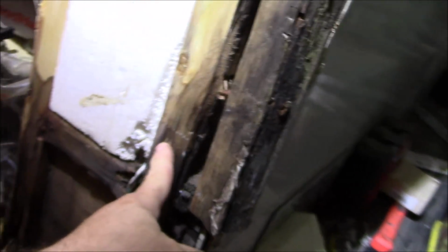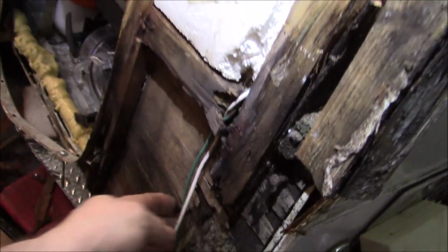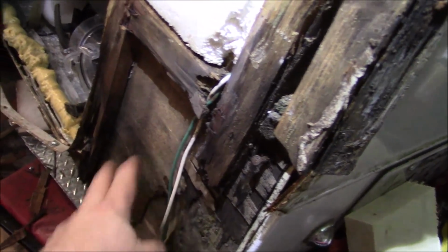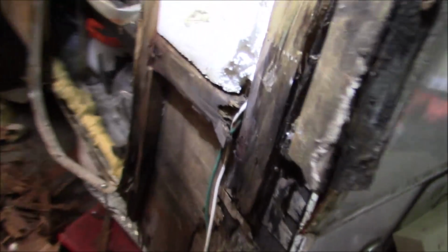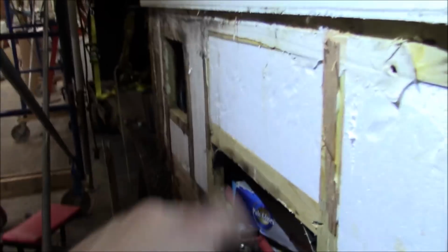We'd put some more struts and everything. Obviously, this is going to get replaced. This goes inside. I'm not going to replace all that, but I will throw some mold kill on there, because then I'll get inside the cabinet, and it's really not necessary. It's just wallpaper on the other side of this eighth inch. That's all it is. And then I'll replace this little stick and everything and reframe around. There's some on the other side, too, that I showed you earlier that was coming apart. So we'll reframe all that and put it together, and then we'll jump on the other side.